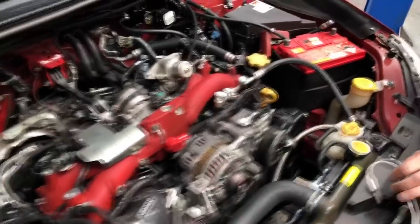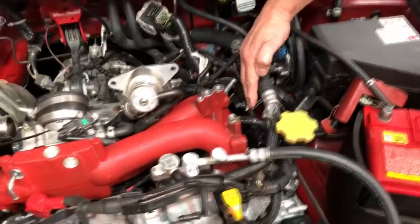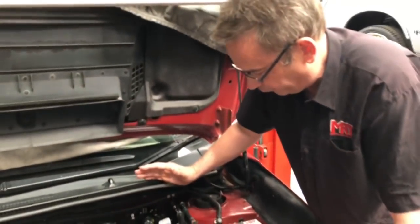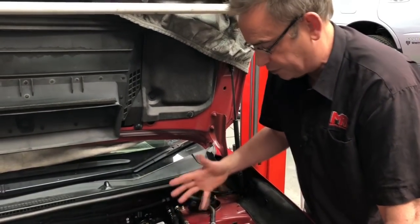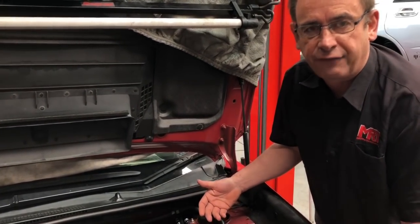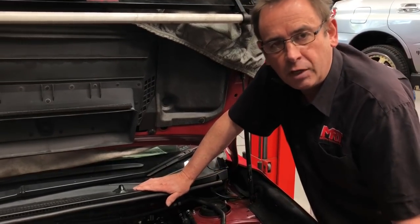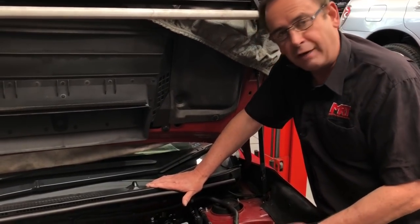The most important thing I want to talk about over here on this side — we're running split fuel rails, meaning that we run one fuel line delivery to one side of the engine and a separate fuel line delivery to the other side of the engine. The requirement to achieve this involves fairly significant modifications to the fuel delivery system from the way Subaru provides it factory standard. Because this current model car has dampers on the fuel delivery line, it has factory regulators to control fuel pressure, and all of these things need to be modified, deleted, or upgraded to make sure that we can deliver the right amount of fuel to run a split setup.